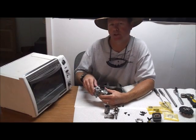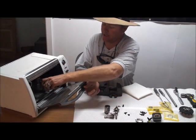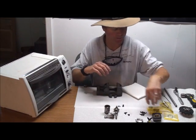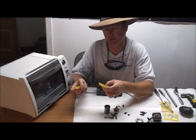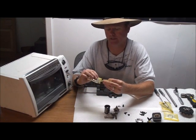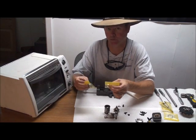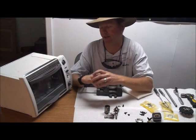I've got the oven heated up to 300 degrees Fahrenheit. I'm just going to take the motor case with the bearings and stick it in the oven and let it heat up. Some people at the same time take the new bearings and put them in the freezer so they contract and will go into the expanded motor. I don't tend to do that — I don't like the idea of freezing them and possibly getting water in the bearings. So I leave them at room temperature. We'll wait about 20 minutes and come back and get the bearings out.